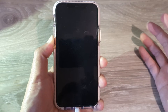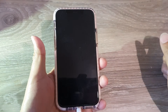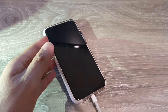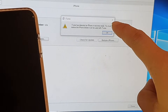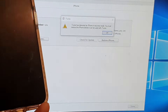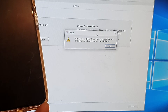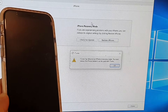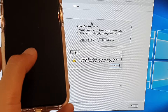When you are doing this in the correct sequence, you should see the screen stays black, but on your computer it will show iTunes is in recovery mode. The phone screen stays black, but iTunes still shows the phone is in recovery mode. Recovery mode is different from DFU mode — it shows iPhone is in recovery mode, but it is actually in DFU mode because the screen stays black.